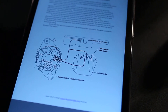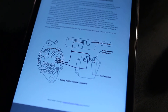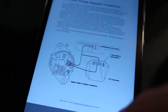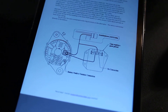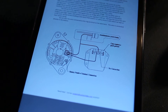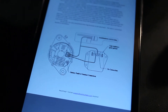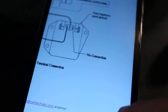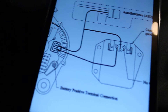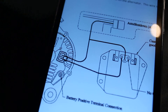This is the diagram from SimTech Labs. You can see at the top that's the auto shutdown relay providing 12 volts — I'm actually ditching that altogether and using my fuse block to provide power for that. You can see it goes to the middle pin, which is the battery voltage reference, and then the top pin of the alternator, which is the positive side of the field coil. The wire connected to the left pin on the voltage regulator is modulating the ground of that so they can control the current in the field windings. When you control the current in the field windings, you get more current out of the alternator — if it sees a low voltage on that center pin, it increases current through the field coils to charge the battery.